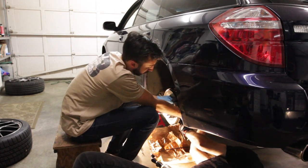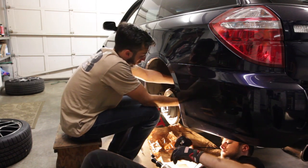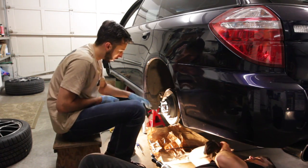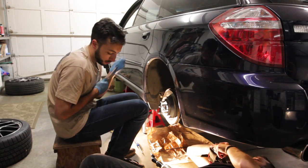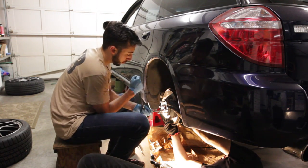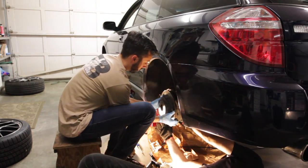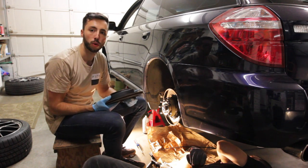Both bolts are out. We're folding that caliper up — the brake line is still connected until we get the new ones ready to go on. A nice little trick we just found out: there are a few threaded holes on the rotor, so you can actually screw a bolt in and that'll press the old rotor off, eliminating the need to pound it with a mallet and wood like we did on the front. Just tighten it down until it pops the rotor off. And that is the last of the four original rotors.